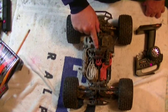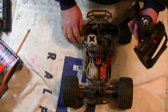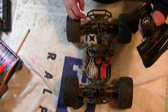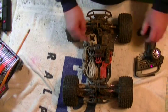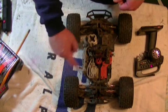The one thing I do on this one to prime it, it doesn't have the primer button. What I do is hold my throttle. I'll get somebody usually, because it's hard with the crank. Get somebody to hold the throttle wide open. Don't put your glow plug starter on it. Hold your finger over the muffler and crank it about 10 times, and that will pull fuel up to the carburetor.